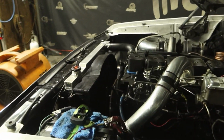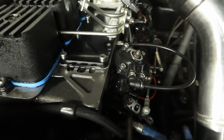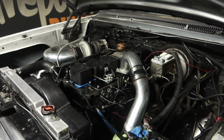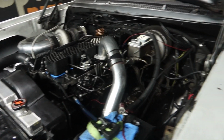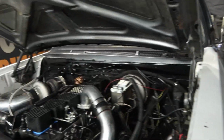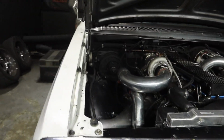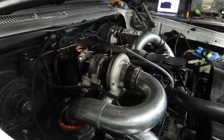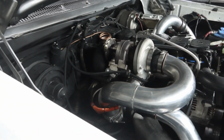We have skipped two teeth and have a good bit of timing in it. It's very rattly. It is up close to the head. These injectors are just monstrous. I don't even know what to really think. It's definitely harder to get on the charger now, but it seemed to like the added timing. But I think there's more in the gate adjustment. I would really like to have a whole other full day with this thing on the dyno, because I think there's something with this gate adjustment as far as where it needs to be. So I'm not completely decided on that.